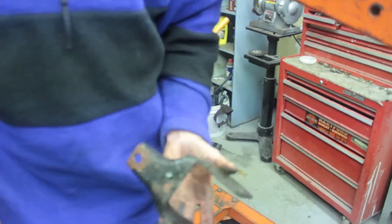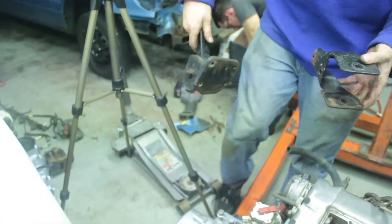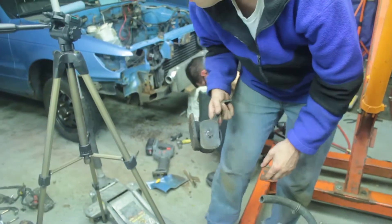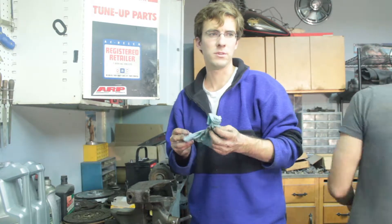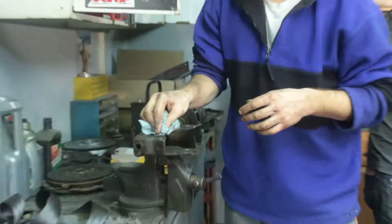This car has really four mounts: there's a rear mount here, a front mount there, a driver's side mount here, and then it also has a transmission mount. This part bolts to the car, and this part bolts here, and then it bolts to the trans. But this is off of the Colt. Your left is the Colt and your right is a DSM — so we're gonna bolt this to the Colt, but now we're gonna need this part. We're using this driver's side mount from a Gen 1 DSM, all-wheel drive. We're using the front motor mount from the Dodge Colt, which actually bolts right up to the 4G63. And then this is the rear mount out of the Dodge Colt — it's a 1.5 mount that bolts onto the 4G63, but we're gonna slightly modify it.